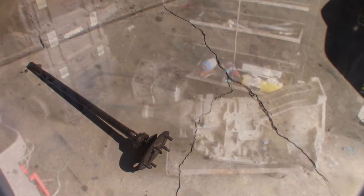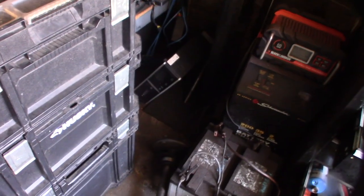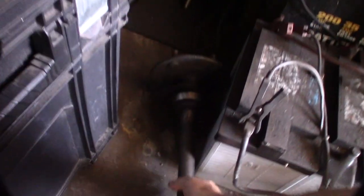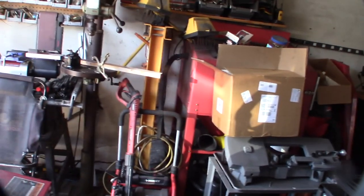Let me show you the other axle. That's my 470W right there — I've got to put it in the Bronco eventually and rebuild it. Here's the original axle — these are 1966 Bronco 28-spline small bearing axles. I'm guessing those are probably the original bearings. But yeah, I'm about to replace the bearings.